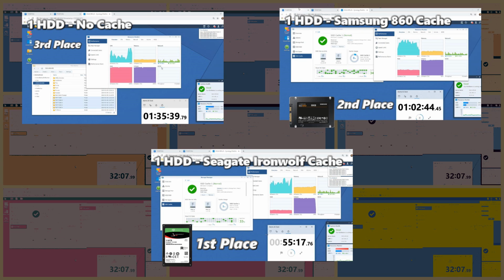One thing I did notice with the Seagate drives is CPU and memory utilization was higher, and I think a lot of that is to do with the triple layered NAND chips that we find in those Seagates, as opposed to the MLC multi-layered NAND chips that we find in the Samsung 860s. I mean, those MLC based NAND chips are much better in terms of the way data is distributed on those chips, and particularly in terms of IOPS, individual inputs and outputs at any given time.